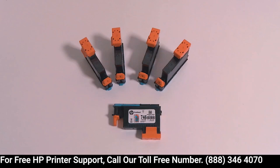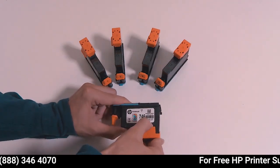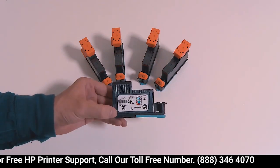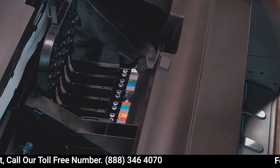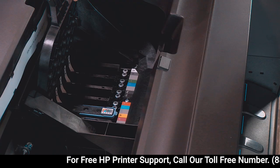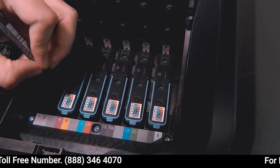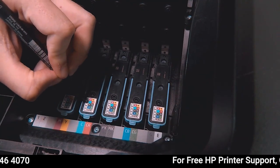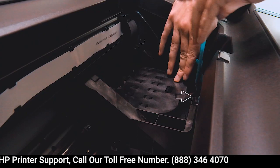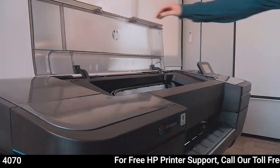When all the setup print heads have been removed, press Next on the front panel. The front panel prompts you to install the new print heads. Unwrap each print head and remove all orange parts. The print head is designed to be inserted into any available slot, but once inserted into a slot it will only work with that combination of colors. Insert the print heads one by one, pushing each into the slot until it clicks into place. It is important to mark each print head with the specific color combination to be used. Pull the handle down to close the cover, ensure that the end of the blue handle catches the wire loop on the near side of the carriage, lower the handle to rest on the carriage cover, then close the top cover.